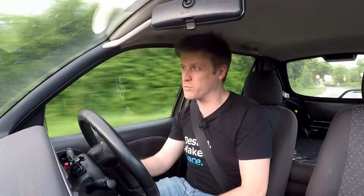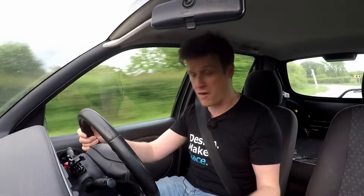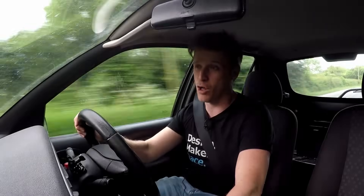One of the things that's quite impressive is the transient throttle. Here I'm going from very low, about 2,000 revs, very low throttle just tickling it, to full wide open - no bucking, no bogging down, nothing. The acceleration enrichment is doing what it needs to do, maybe not perfect but close enough. The whole car is coping really well with having a completely different set of pipes. With more time to tune this setup I think it would be perfectly adequate with a 3D printed plastic inlet manifold and throttle bodies - though the MAP sensor's not working. You can't really argue; must be magic.